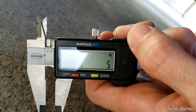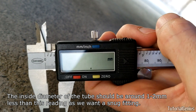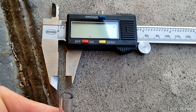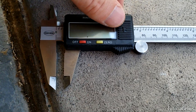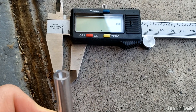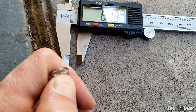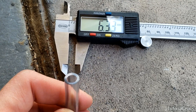This is the brake caliper here, here's the brake line where the hydraulic fluid sits, and up here is our little nipple — that's where we'll bleed the brake. There's a little rubber cap on here, and what we need to do is get some digital measuring calipers over the end of this nipple to determine the inside diameter of the tube we need. I found some tubing with an inside diameter of 0.25 inches, or roughly 6.33 millimeters. It's slightly smaller than the nipple, but because it's made of nice soft material it's not going to accidentally slip off, so this is really good for us.